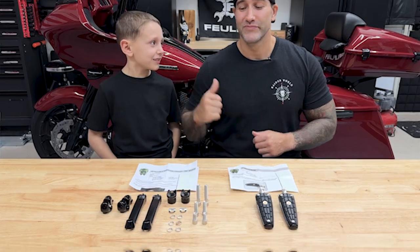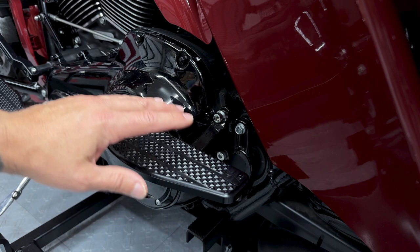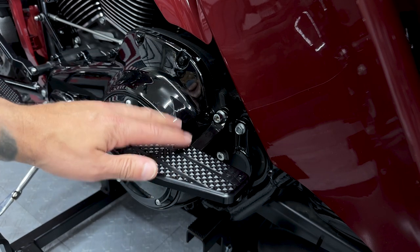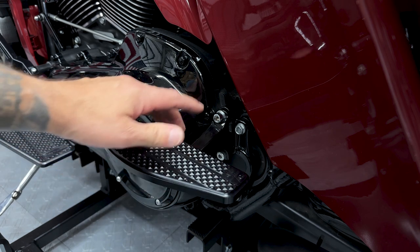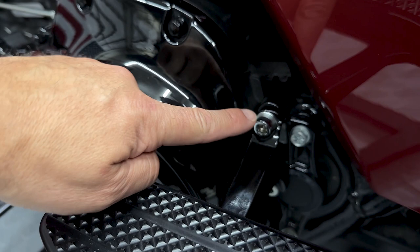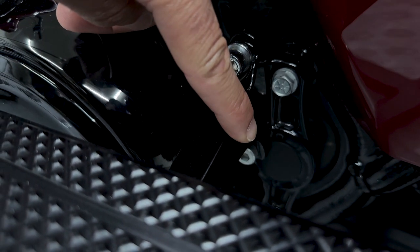Yeah. Let's go. Now, I do have the Thrashin Supply passenger floorboards. If you want to know more about these, I'll put a link down in the description below. Now, you don't have to remove the passenger floorboards. You just have to remove the top screw and then loosen up the bottom screw. The top screw is a 5/16 hex bit, and the bottom screw is a 1/4 inch hex bit.